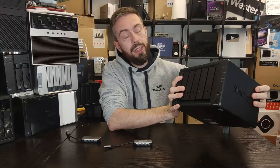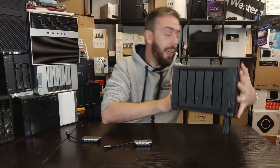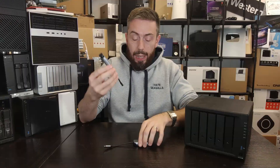Systems like this one — the DS1522 — can actually be upgraded to 10GbE thanks to an expansion adapter. And there are a lot of Synology NAS devices out there where you won't need to go for 5G. But unfortunately there are also a lot that have no means to upgrade their network ports, and being stuck at 1GbE can be something of a bottleneck these days.